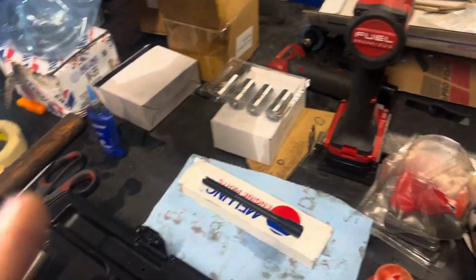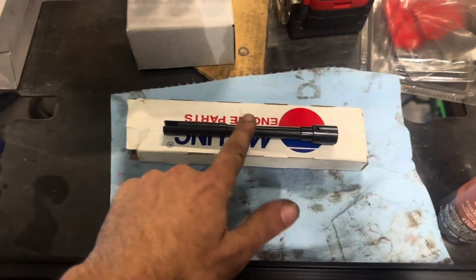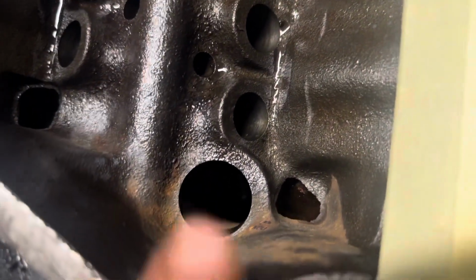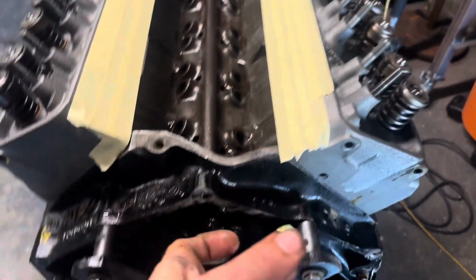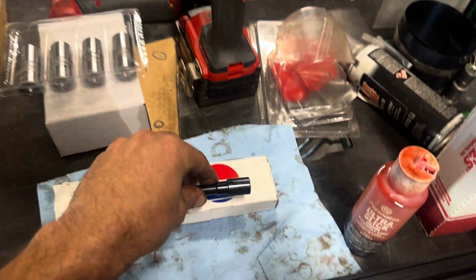I did goof up a little bit though. I'm sure you guys who are familiar with the small block Chevys caught this, but I couldn't get my intermediate shaft to drop down through the dizzy hole over here. Unfortunately, it's got to go through the bottom. Now I was hoping I could drop it in there because I couldn't get it to stay on the oil pump from the bottom, so I may have to put a dab of grease or something inside of this collar here to get it to stay where it is.